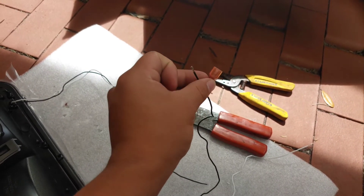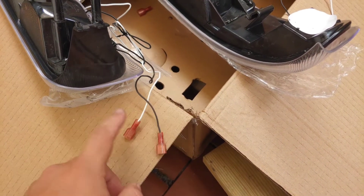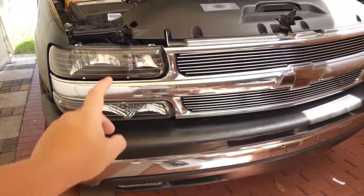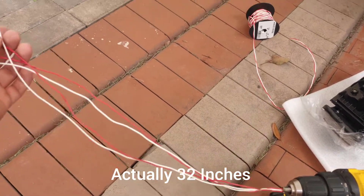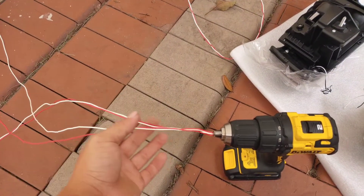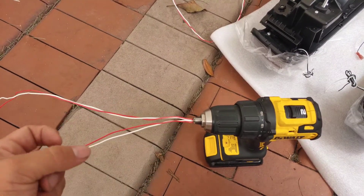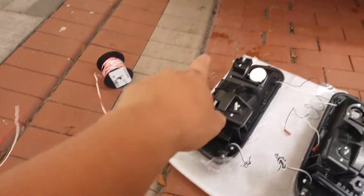You can see I already have my female connectors on all the ends. Now I'm gonna start removing the headlights. I've got two and a half feet of new wire - two positives and two negatives. The red is my positive, the white is my negative. I separated the wires and twisted them all together so I can run this from the fog lights up to the headlights.